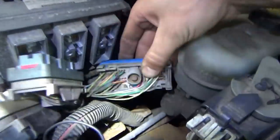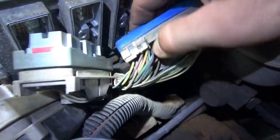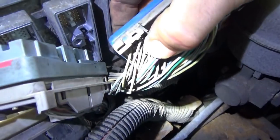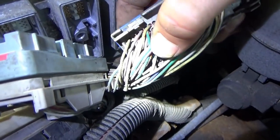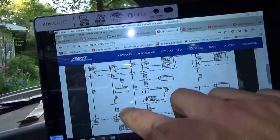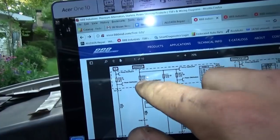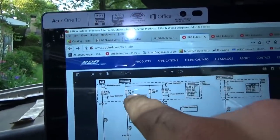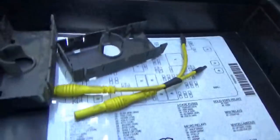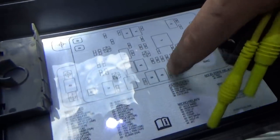This is great — we're so close to calling a PCM. That just proves you cannot, cannot prematurely call computers. No way, no how. There it is — pink wire. Pin 19 is bad. 20 and 21 are good. Let's see where pin 19 comes from — it comes from PCM1 fuse 28 in the fuse block under hood. Let's check. Fuse 28 PCM1 — right there.